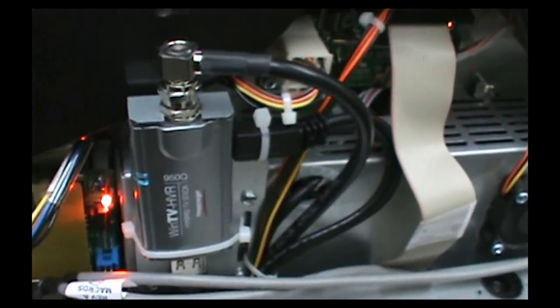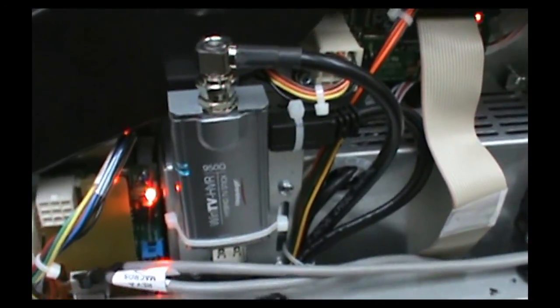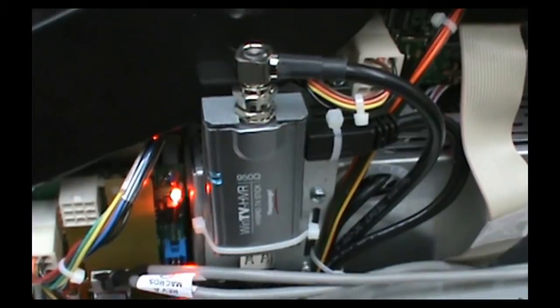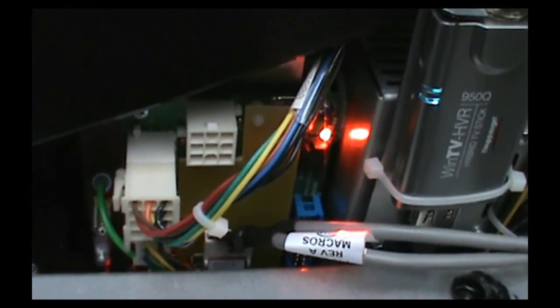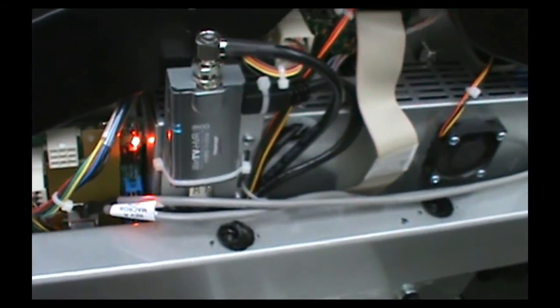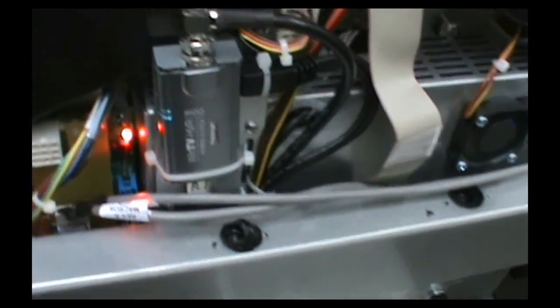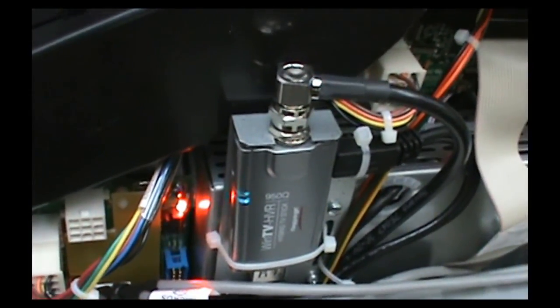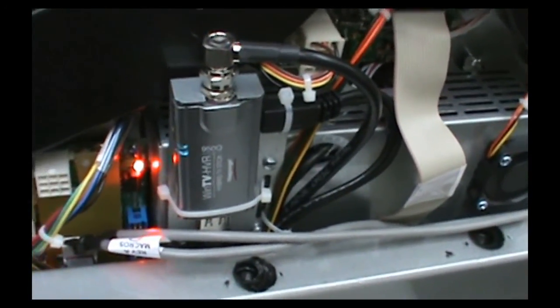Going forward, what's going to happen is if you do have a tuner card issue on an embedded screen, you don't have to replace the whole screen — you can replace just the tuner card itself. Everything else is pretty much the same. You still have your connection over here, your fit CPU. If you look down below on our interface board, pretty much the same connections — they've moved around a little bit. The major change is this tuner card. Also there may be some changes on the way that you do your channel scans, and we'll show you that as well.